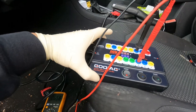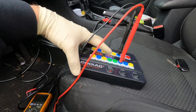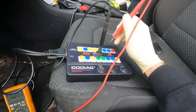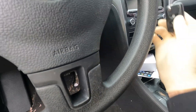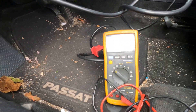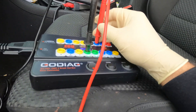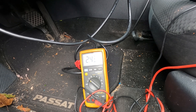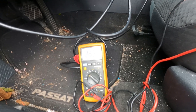We'll turn this off. I brought out this test box and I'm testing CAN low and CAN high circuit for resistance. We got 67 ohms — that's good, we should see about 60. Moving to CAN low and chassis ground, key on, we have 2.43 volts on CAN low. Usually CAN low is about 2.2 to 2.3, and CAN high should be about 2.7 — but we also have 2.4.